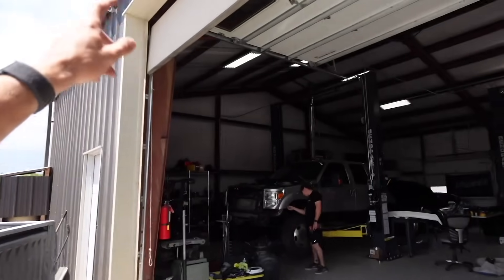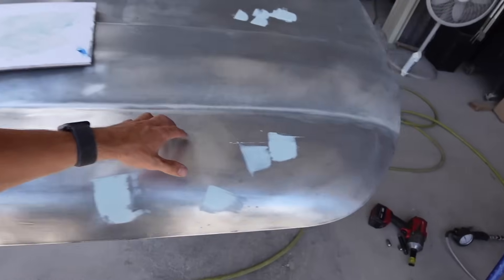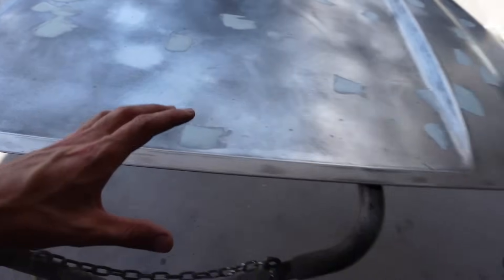We also pulled off the hood on the truck. The hood had a bunch of tiny little hail dents and stuff in it, so we went ahead and pulled it off. We stripped it all the way down because the paint was not that good on it. And now going over all these little spots with the icing, which is just a super light coat of body filler. Then we'll hit this with primer today as well. The goal today is to just get a lot more stuff in primer - I want to get all the sunny stuff in primer.